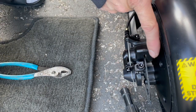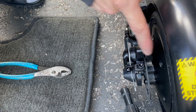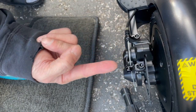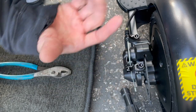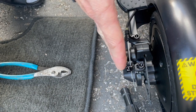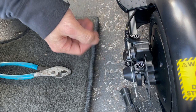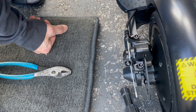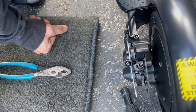On mechanical disc brakes, usually the pad on the inside stays fixed — it doesn't move. The pad on the outside is the one that moves. It moves in, squeezes, and pushes against the rotor, but at the same time it pushes the rotor towards the inside pad. So you see that deflection?